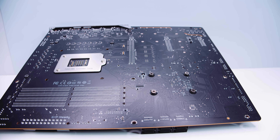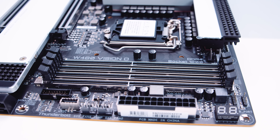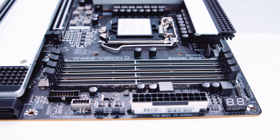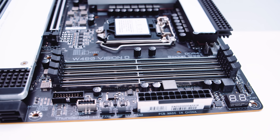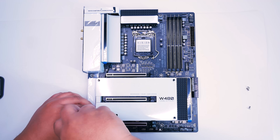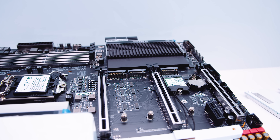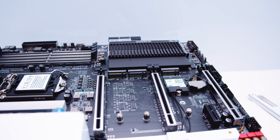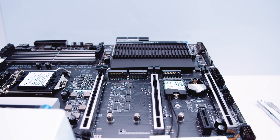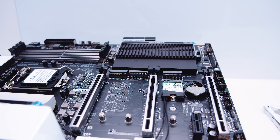The back of the board is pretty bare, as expected for a workstation-focused motherboard. This board supports ECC memory — up to 128GB of unregistered ECC — and also supports regular non-ECC memory, with a maximum speed of 2933 MHz. Pulling off the M.2 heatsink, this board has an interesting configuration: the top two M.2 slots support PCIe Gen 4 drives, and the top two PCIe slots also support PCIe 4.0, with an included clock generator for future processors.